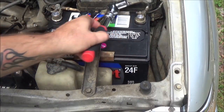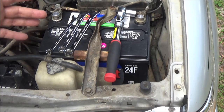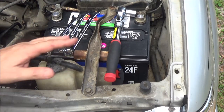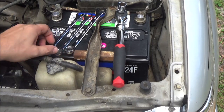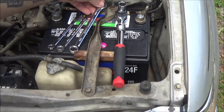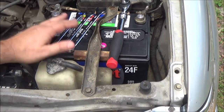This is all you're going to need on this particular truck. This is a 2004 Toyota Tacoma — I know I've said 2003 in past videos but it's the same thing. It was built in 2003 but came out after June, so it's actually a 2004. You're going to need a 10mm, a 12mm, and a 14mm — these are box wrenches. For the longer bottom bolt you may want to use a ratchet wrench. If you have two 14mm wrenches handy that will work as well, it just doesn't go as quick.